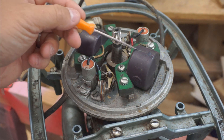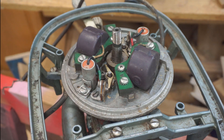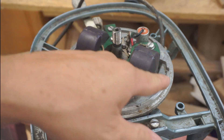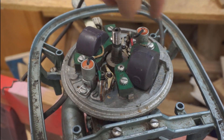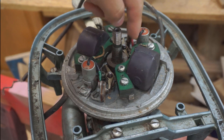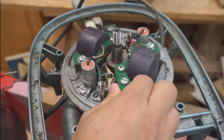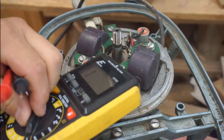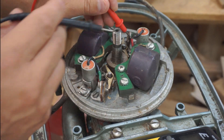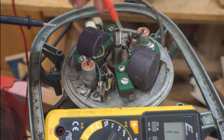We tested the ignition coil. Let me show you how to test that. The ignition coil is made of wires wound around — it's called a primary winding — and then you've got a secondary winding. When the magneto is going around, that's where you're creating your spark. First you want to check the primary coil to see if there are any breaks. There are two wires. Set your multimeter for a continuity test. Touch the two wires, and if you hear a beeping, that means current is going through the wire — so it's not broken.